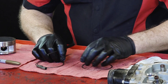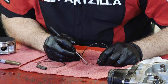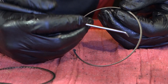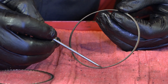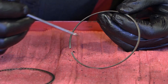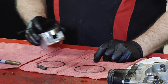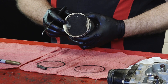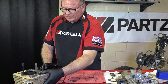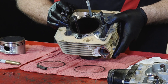Putting that aside and looking at our oil rings — come in here and look at this. This is one of our oil rings, I think the bottom one. As you can see, it is so thin right there compared to this side, which is probably twice the thickness. So it is worn kind of like an egg here and here while remaining true on the other ends. So how are we going to fix this? We're going to move up to a plus one piston, which is going to increase the bore of the machine by just one size. Go ahead and replace the piston, the rings, and we'll take all that to the machine shop with our existing cylinder and have them bore it out to match. So that'll be the next move we need to make.